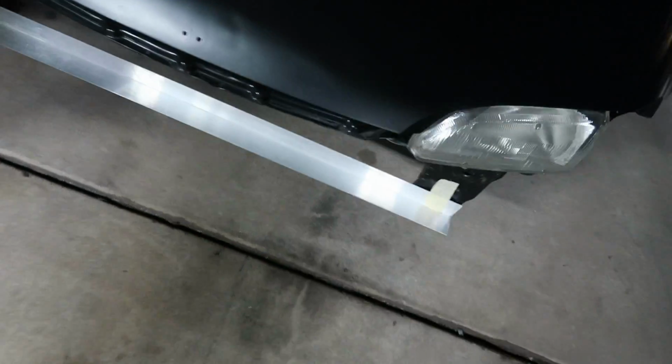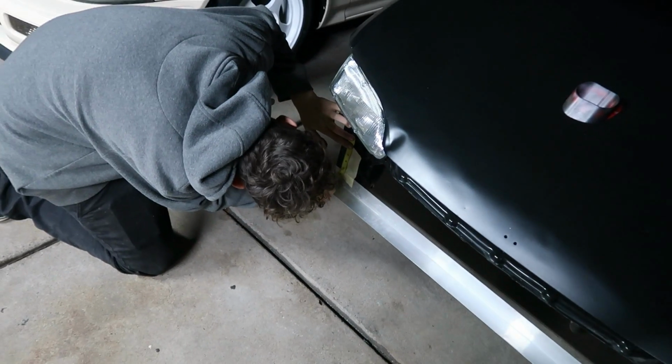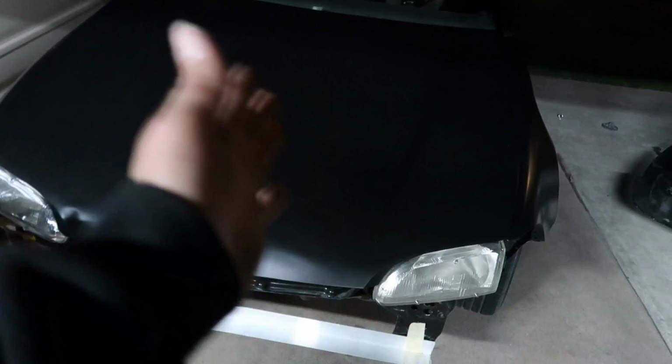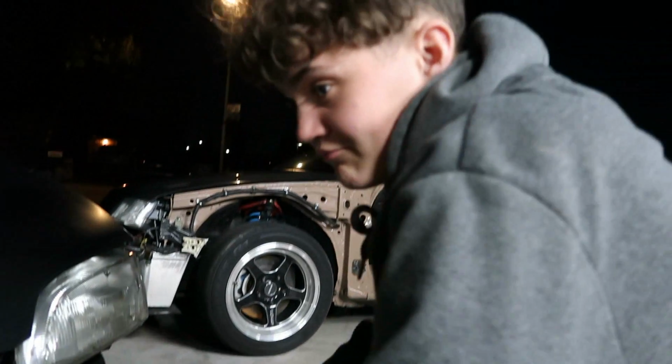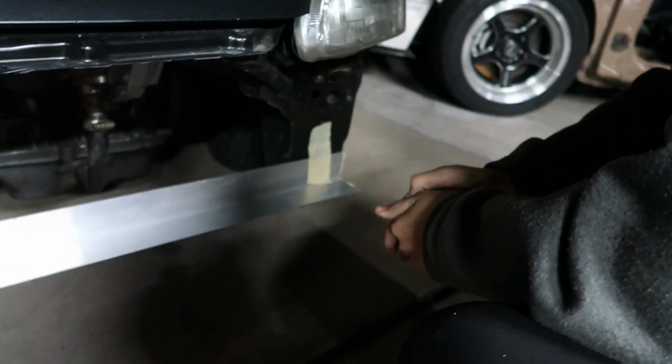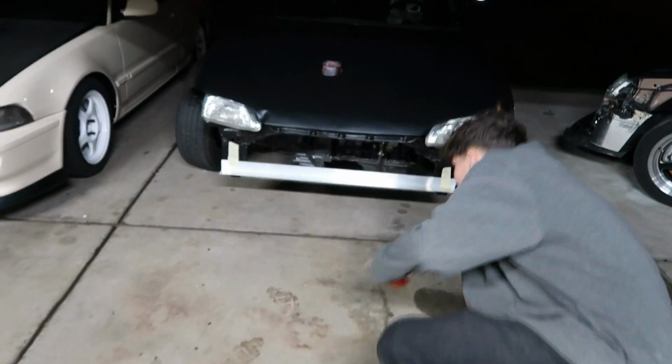What makes you think the driveway is level and that the car is sitting level? Did you check and make sure you have the same tire pressure on the left and the right? As a matter of fact, you might want to straighten the car out a little bit. Hell, the wheels are even turned, so I'm sure the steering geometry has the car sitting a little weird. What's your conclusion? The right side needs to go up, or the right side needs to go down? No, up. Looking at it, the right side looks like it's sitting up higher than the left for sure.